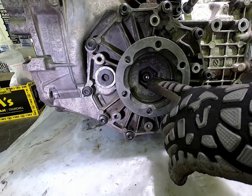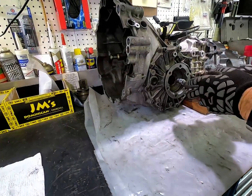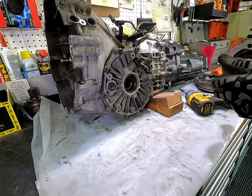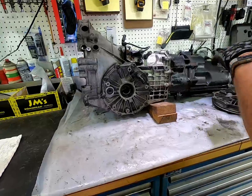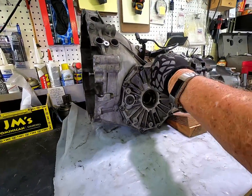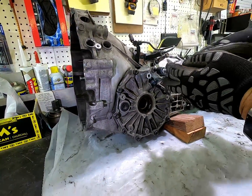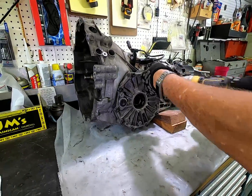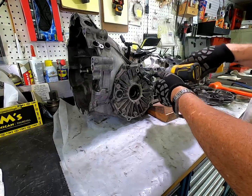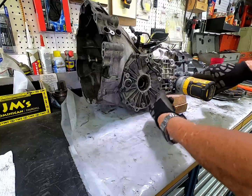What we're going to do is show you how this comes apart and what you can do. You could just take this sensor off — it's an Allen number six. You pull the bolt and it slides right out. Next up, these are T45 Torx and there are ten of them. When I go to take them off I take them off in a crosshatch pattern, because that's the way you put them back on too.